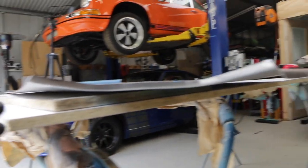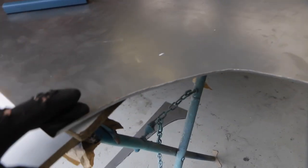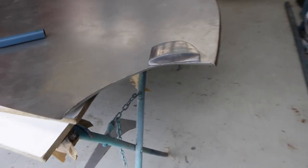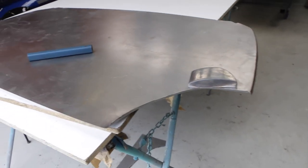I'll show you here in a little bit more detail about what we're going through. You can see how much the panel has curved and warped because I'm bending this edge up. I've got a good start there but obviously I want this to be nice and flat, and it's a long way from it. I managed to get it nice and flat over here — you can see it sits nice and flat down there. It's just this warp coming through the whole panel from here. What I'm going to do now is with the dolly, concentrate on putting force on this side and tapping it up. I need to stretch out these corners because the metal's not stretched — that's what's bringing this all up. I've been watching a lot of Trev's Blog, and he's got lots of good tips on sheet metal work — I highly recommend it.